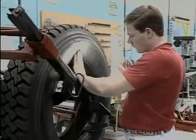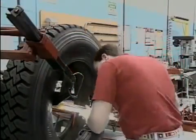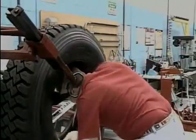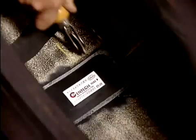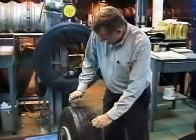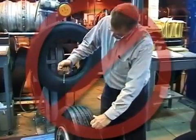In addition, if you experience a flat tire, it is important to have the tire demounted from the wheel, inspected on the inside for any other damage that the penetrating object may have caused, and properly repaired using accepted industry repair procedures. Never have an on-wheel plug repair made to your tire.